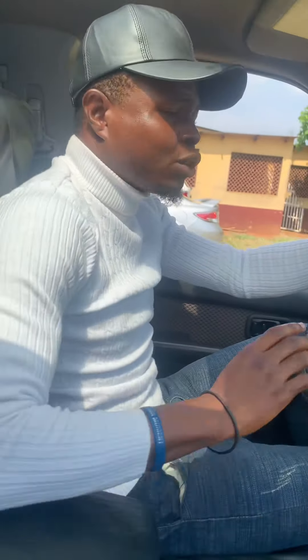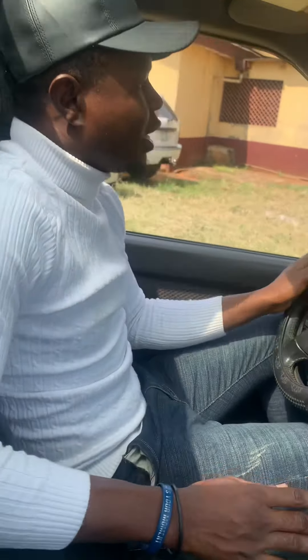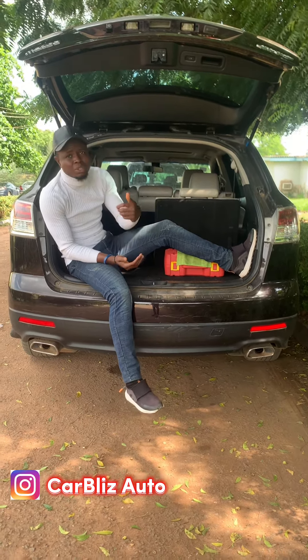That is how to pick up a car that is already parked, on a daily basis. Now this car is on handbrake and in park. If you want to engage this car, the way most of us do it is: we release the handbrake, remove the leg, and then put the car on drive. You are still damaging your transmission box using that way. Because immediately you release the handbrake, the car still tends to shift a little bit and rests on your parking pawl. So the best way to avoid this is: when the car is on parking brake, just engage the car on drive, and then release your handbrake or parking brake. After doing that, you can easily move the car.